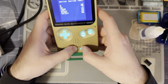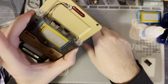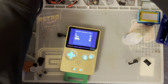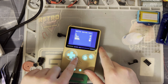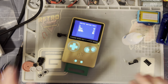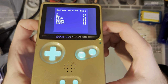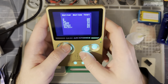If you're having a similarly unfortunate experience as far as I am with your slate and your buttons are sticking, I'm not 100% sure what the fix is. Other buttons work, I can tell you that much, but I don't know how many are making clear buttons besides Funnyplaying, so that's kind of unfortunate. I think breaking the edges on the inside of the button wells of the shell itself, skate across it with a file real quick, I think that should solve the issue because it feels like it's just getting caught on the edge. It feels like the tolerances on these buttons are just a little bit different. Unfortunate. I'm sorry, guys. Had I had these buttons when I was designing this, I would have made sure they worked.